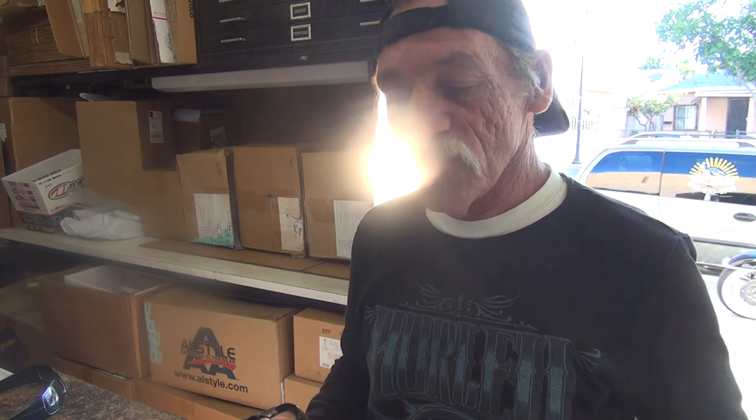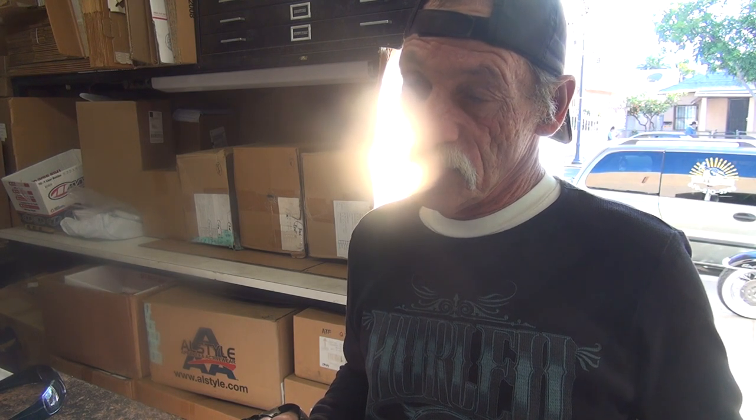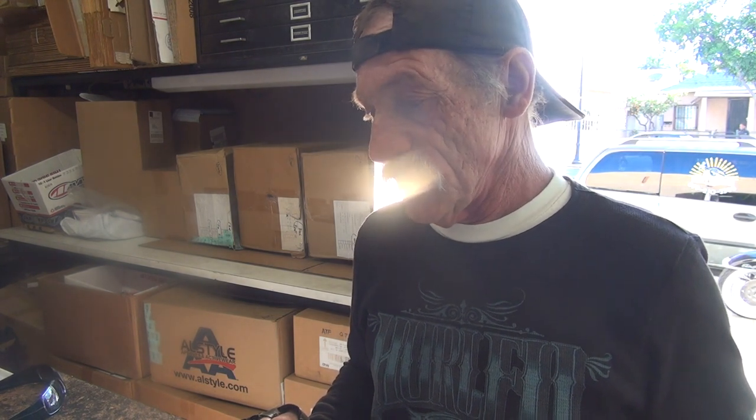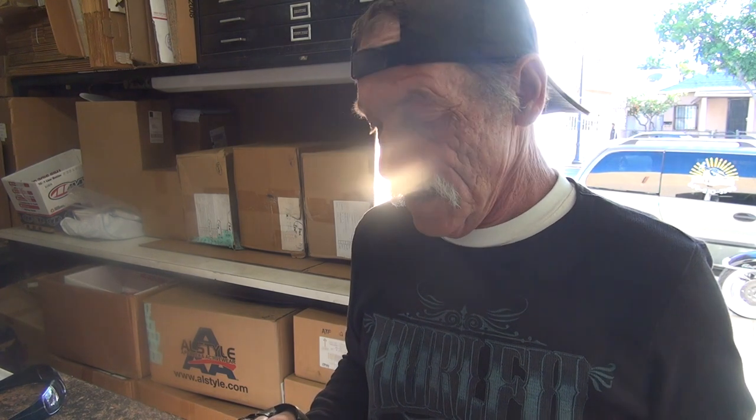Yeah. You want everything. But if I'm going to take the heads off, I might as well go with the 300H compression releases. The 300H will bolt in. The B grind, I'd have to see about the lifter deal, but it'll probably clear. The 300H? It'll probably bolt in. No, the B grind. But I don't know if the B is hydraulic. They don't tell you. It's a secret.